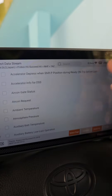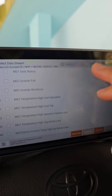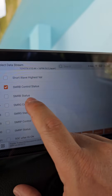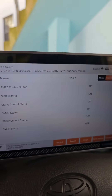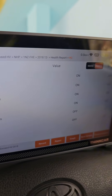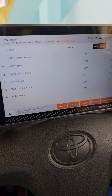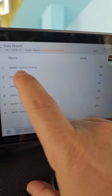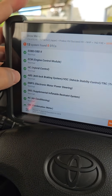Going to Live Data — I can select all modules and it reads absolutely everything. For example, if you want to diagnose the ignition system you can check the system relay positive status, ground, and pre-charge relay. I'll switch the car off and back on so you can see the pre-charge relay activate first, then the system main relay positive — a very nice sequence to verify.